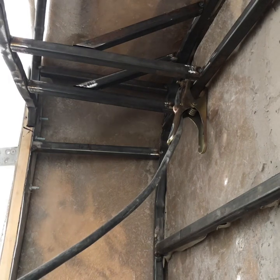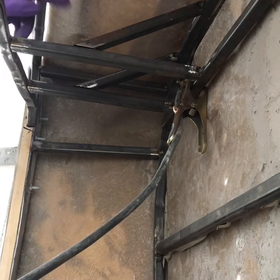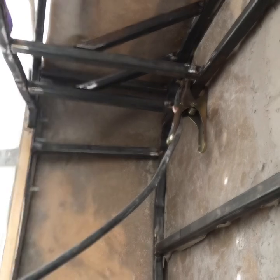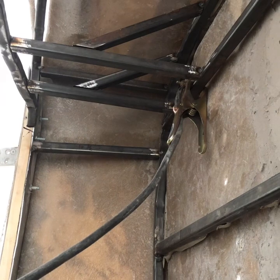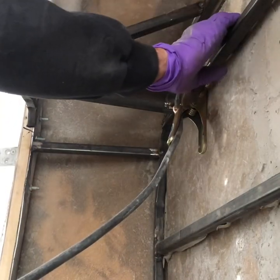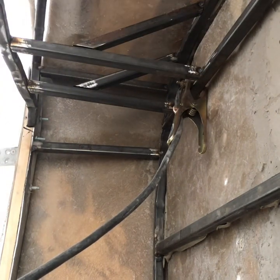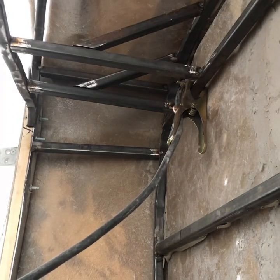And then, like I said, I might come up off of here to here, maybe. As a little extra. I mean, I would come here to here. Like I said, what I showed you earlier with that drop in here, it's not going to work. I'm going to hit it. So, all this right here is going to have more glue on it. This polybond, it's going to go in behind it. So, I got hit with 40 grit sandpaper. All this in here. All that's going to be poly bonded. Every piece of that's going to be poly bonded to the fiberglass all the way around.